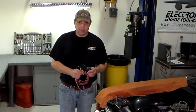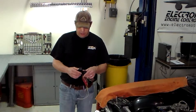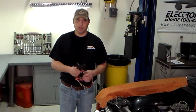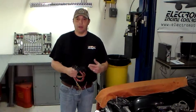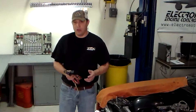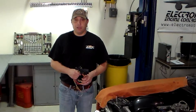If you're using Electromotive's fuse and relay block, we do sell additional fuse holders that you can link together with the existing relays and fuses. So if you need to add additional relays for whatever functions and you're using this kit, consider buying your relays and fuse blocks from us. Lastly, try to mount them relatively close to the ECU — it'll significantly simplify the installation and require less wiring to be run through the vehicle. If you're building a panel to mount the ECU like we are, consider mounting the fuses and relays directly to that. It'll make the installation go a lot easier, you'll be able to do a lot more wiring outside the vehicle, and it'll be a much less painful process.